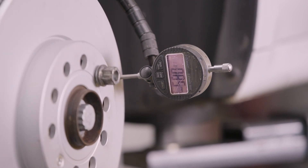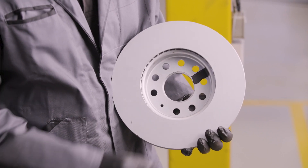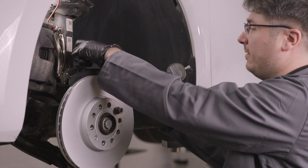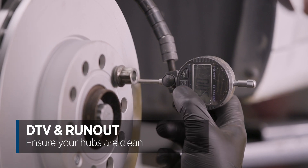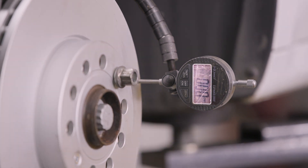Now we know that the disc has the same thickness the whole way around as we checked it previously. So is this disc warped straight out of the box? No. You can see here that there's a small piece of tape on the hub behind the disc. This is there to highlight the importance of ensuring that your hubs are cleaned as much as possible before fitting new pads and discs. If your hubs are already clean, it may be worth then looking into whether your bearings or hub could be faulty.